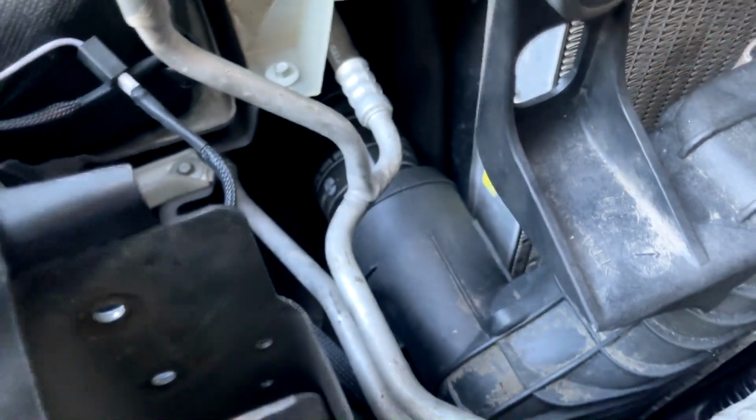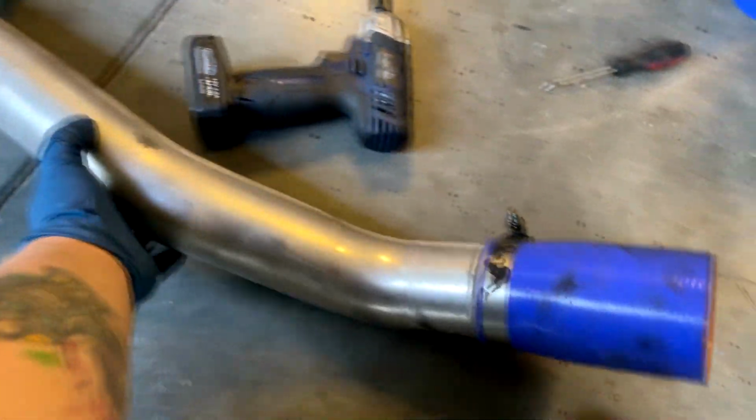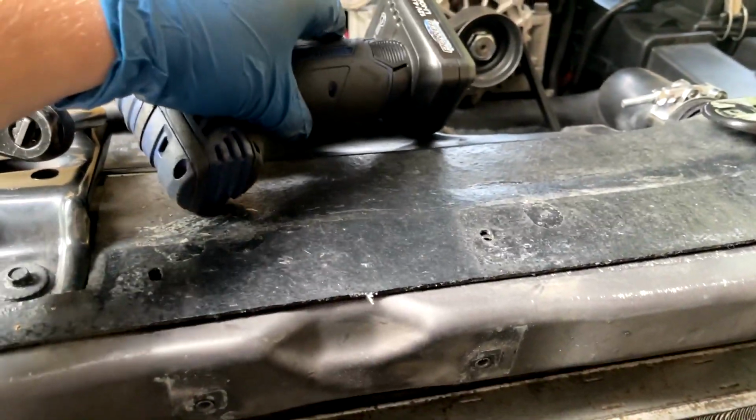Now what I'm going to do is slide the boots in, and obviously we're not going to use all 8 inches here. So we're putting the pipes back in. I went ahead and cleaned this one up a little bit. At least in my case, I had to cut 2 inches off of the hot side. So 2 inches did the trick. You guys can see we're right against the knurl, to stop it, and then it lines up on that spider, no problem. So 2 inches was really an easy swap. It took me maybe just an hour.